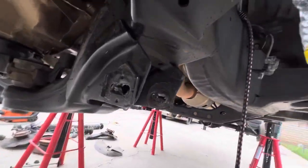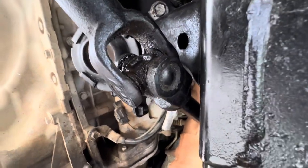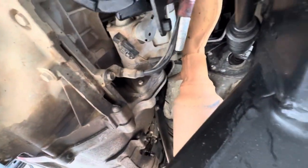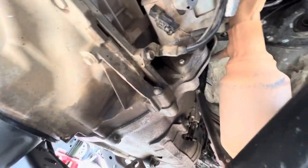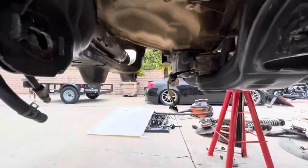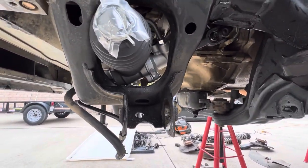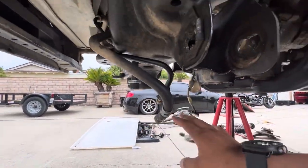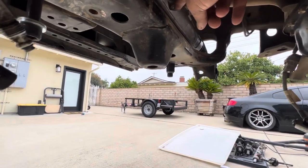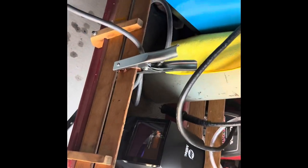I put it in there, held it down, and I was thinking it doesn't have to modify the sector shaft but on mine I'm clearing it — everything clears on the sector shaft. We'll see when everything's finalized, but as of right now I'm really excited — I don't have to cut anything, everything fits. The next step is welding this in. I'm gonna cut this off, grind it down, and then add my other plate that I put my third member to. I got my welding cart — hell yeah.